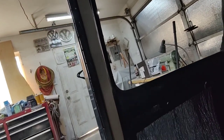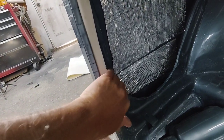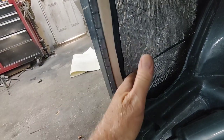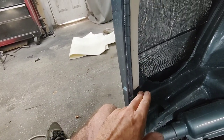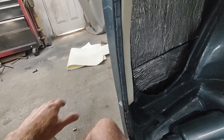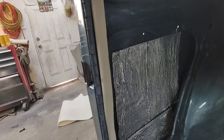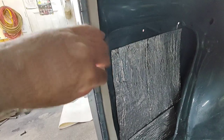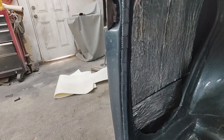Then I'm gonna put 1/4 inch foam over that. So 1/4 inch over that and kind of wrap it, and then I'll have the cloth go over that. So they used to make this like a cotton batting, and they don't, I mean, I'm certain you can get it somewhere, but it's not readily available anymore. Most of your upholstery supply does not carry that, so you have to work it out with other stuff.